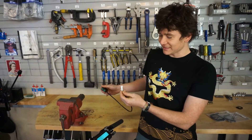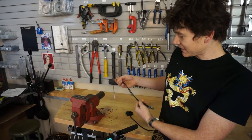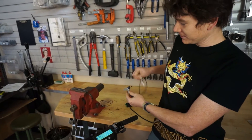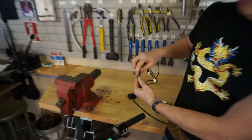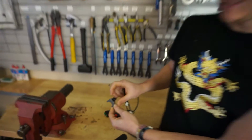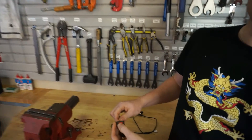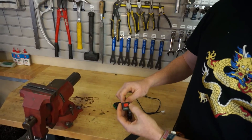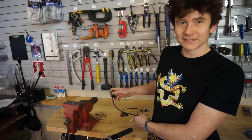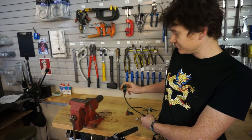What's great about this is it uses the existing auxiliary input plug that's present on the Cycle Analyst. In the past we had two options for the auxiliary input. One was a potentiometer — you twist the dial and set any of your limits up or down, such as the power limit, speed limit, or pedal assist assistance. We also had a three-position switch for three discrete steps. The button has the best of both worlds — it has the convenience of a digital input with known preset values but you're not restricted to just three levels.